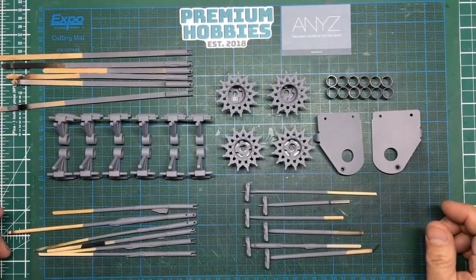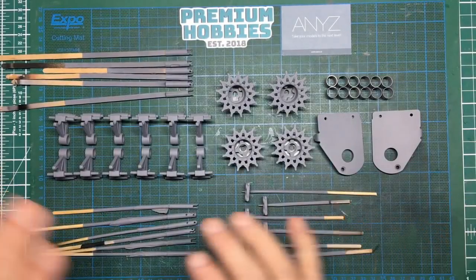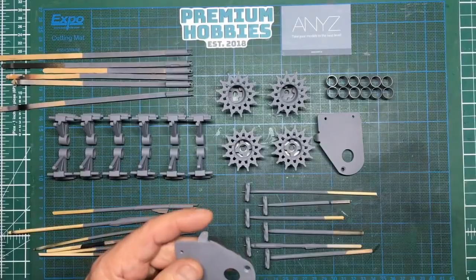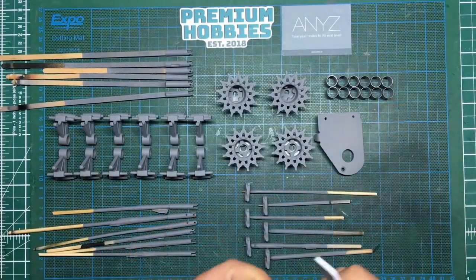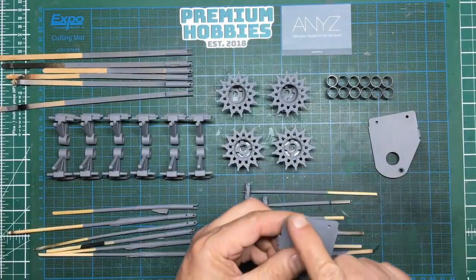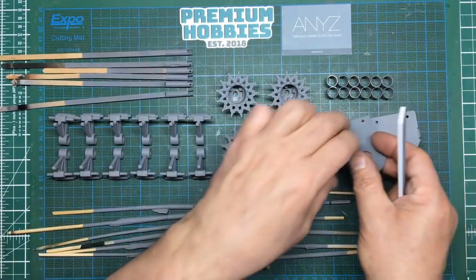By magic, there we go — all painted up. It's been painted about 18 hours ago now, so ready for de-nibbing, flatting back, and getting ready for some green paint. I've got a 1000 grit stick here, just going to lightly rub over to smooth them off. I'll be painting all around the edges, then bolt them on and paint the whole thing completely in one go.